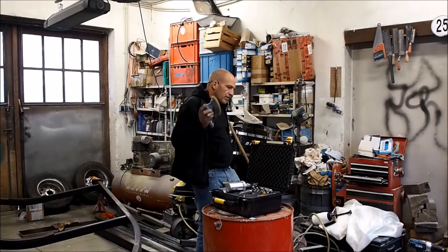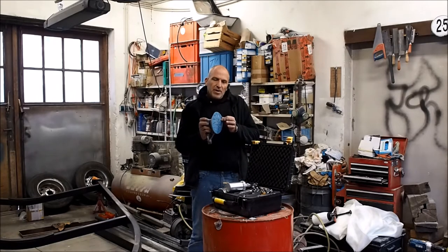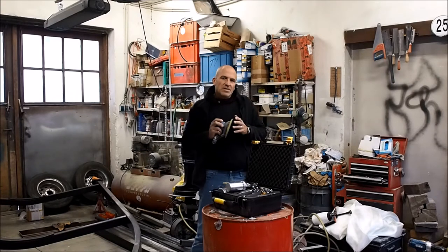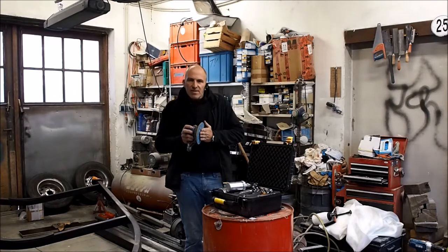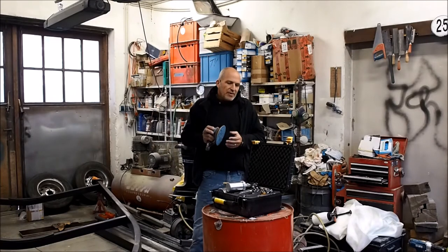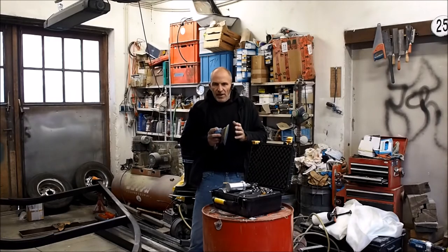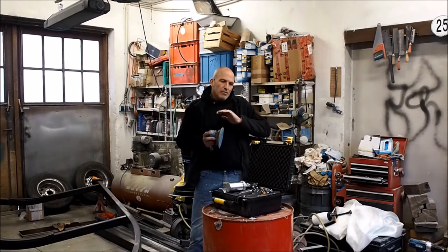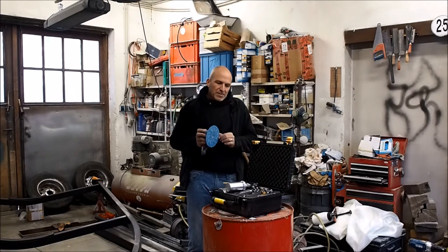And what I use is a foam pad between the sander and the sandpaper, especially if you go towards the edges. Be careful. If you hit the edge of your project with the sander, you will sand through these flakes like this. So be careful. If you're unsure if that works, do it by hand and use a foam sponge or something in your hand to follow the contour of your project. Never hit it with the sander or use one of these thick foam pads.